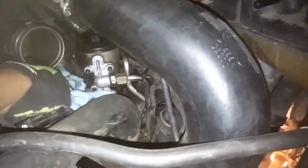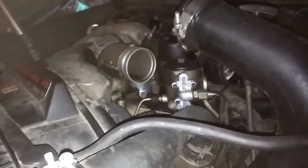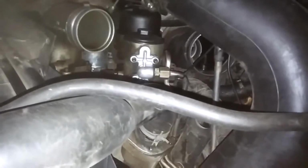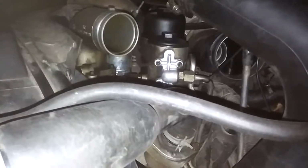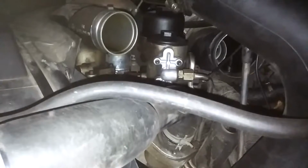I haven't done a review on it yet because I wanted to wait, and it's probably going to be a biased review now, but I bought a three-pod gauge pillar system from Glowshift. The three things I had monitoring were the exhaust gas temperature, which I'm doing the probe for right now, so that wasn't hooked up, but the gauge is inside already. And I had the fuel pressure and transmission temperature. Well, I was having problems with my fuel pressure gauge saying that I was running 96 psi, and I knew I wasn't. I put a manual tester on the fuel line. I wasn't running the factory 40 or 45, I can't remember.